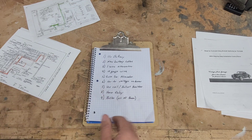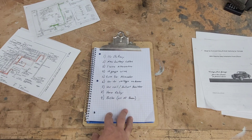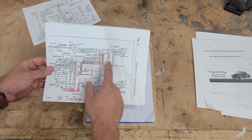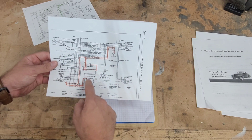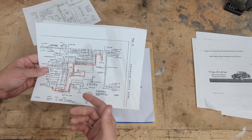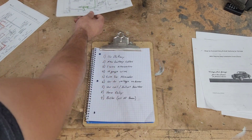Nine, bulbs - you're going to need to switch out all of them: the dome, the dash, headlights, taillights, blinkers if you have them. Everything needs to be 12-volt. And then also, I'm going to include links to wiring diagrams. They're going to be helpful to understand what you're looking at and what wires go where, and I've kind of highlighted the ones that we'll be working with. In case you run across something you're not sure about, it's always a good idea when doing electrical on a vehicle to familiarize yourself with these. This is the Chevy one and this is the GMC one - I'm going to put links in the description.